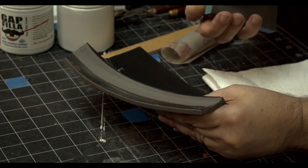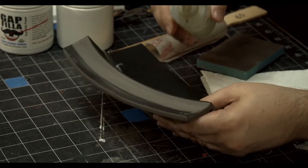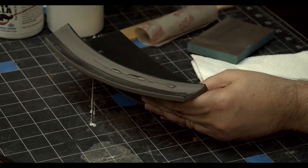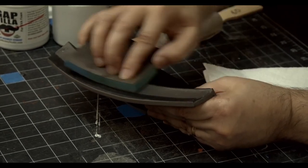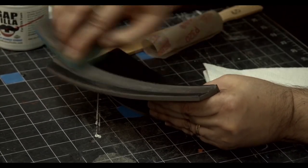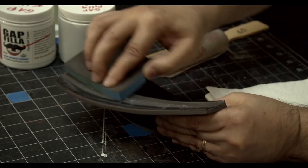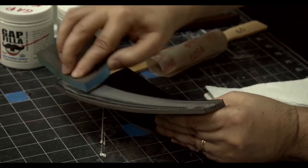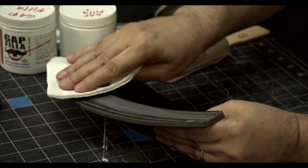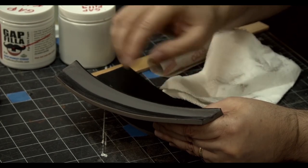I can even do a wet sand on the feathered edge. I put some water on there, rub it in, then take the sanding pad — it creates a nice film and cuts in really nicely. Look how aggressive I can get with this 120 grit, then just a wipe back. That is super smooth — that transition is just awesome. Great on feathering transitions.